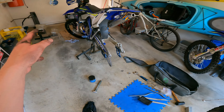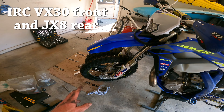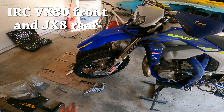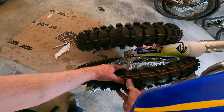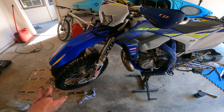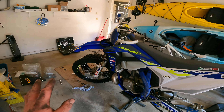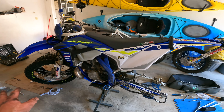I just did the front tire as well and the mousse in there is an SRT brand. It's got well over 100 hours on it. It's getting a little bit smaller and it feels great because it's nice and soft now. But I may change that one on the next tire change — so another 35 to 40 hours is what I get on those IRC VX30 front tires.